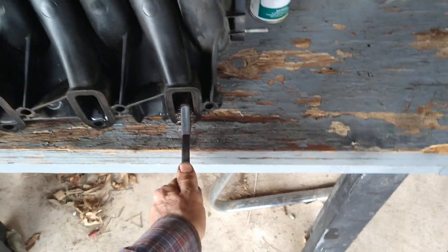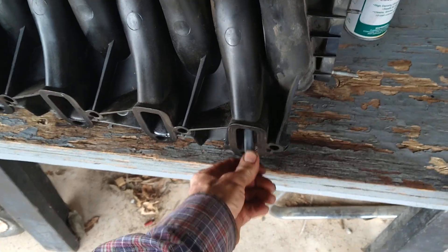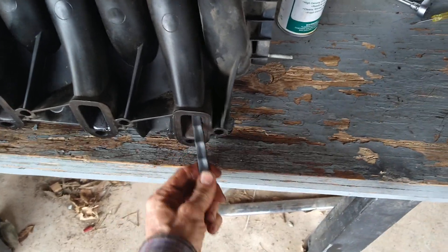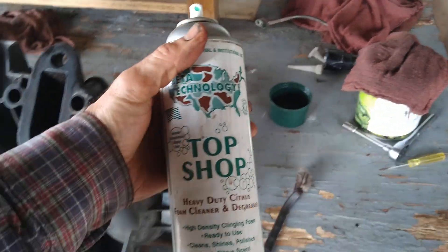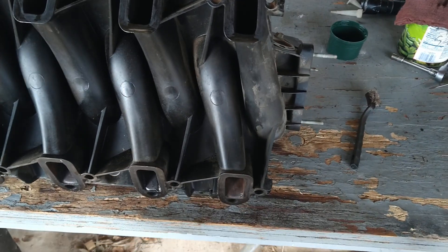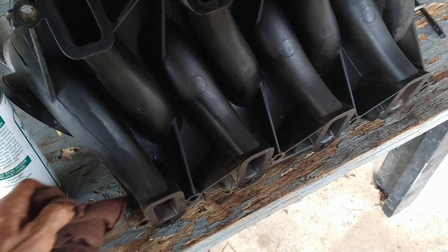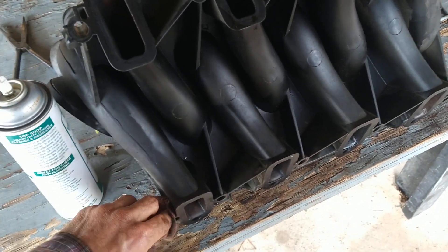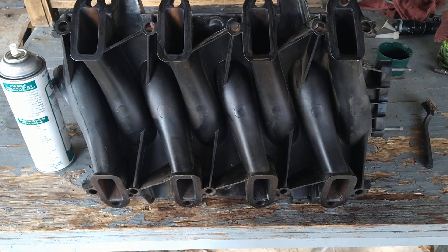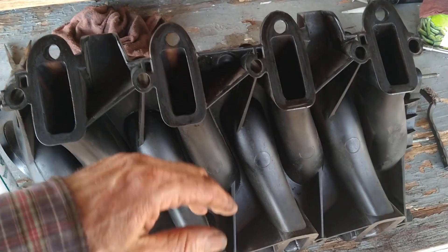It slows airflow when there's all kinds of rough surface instead of being smooth like the outside. While it was dry, I ran the brush all the way up in there as best I could to get that stuff out, turned it over, and cleaned it all out as much as possible. I was recommended to use engine degreaser because alcohol and brake cleaner could be a bad thing on the plastic — don't want to mess it up and have to buy one. The engine remanufacturer has a label stating to thoroughly clean the intake manifold or replace it to prevent any debris from getting into the rebuilt engine. You don't want that crap getting in the heads, getting stuck on the valves, or caked on the pistons and rings. It needs to be clean.